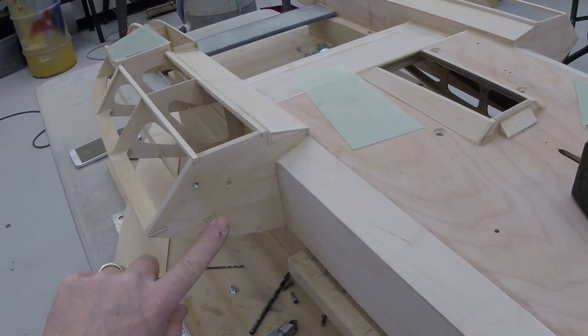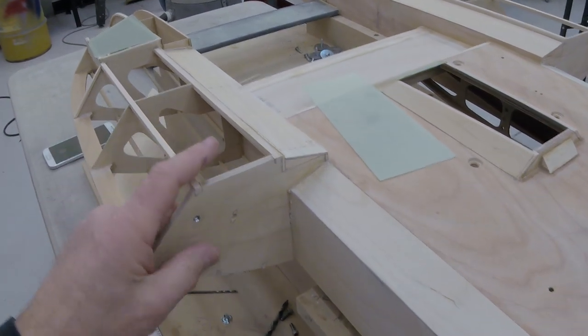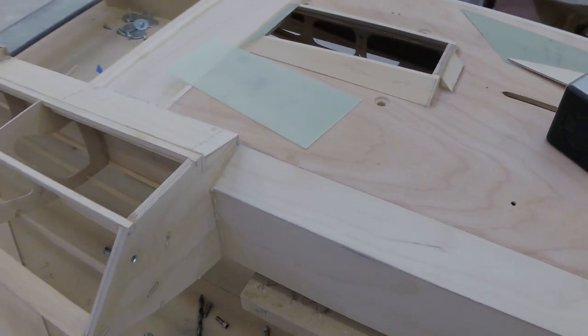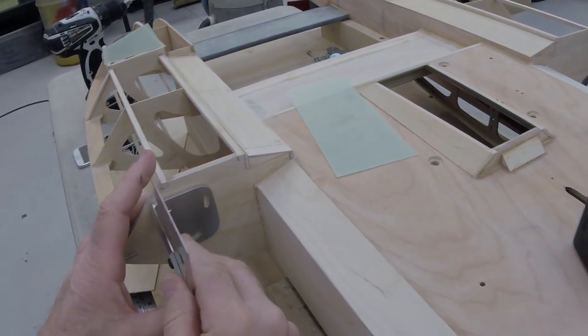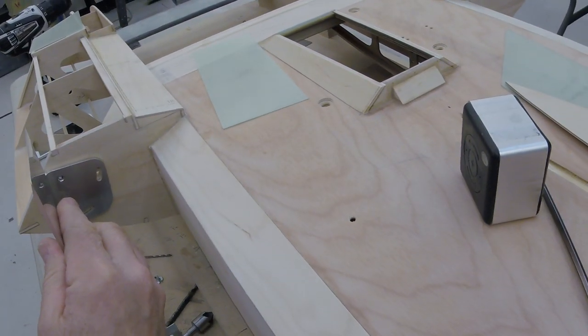Even if you don't have an adjustable bracket, you know, pick a spot. Maybe you want 12 degrees, maybe you want 14. I really think I'll probably wind up at about 14. It's where I usually hit. I don't use curved fins. I think curved fins are super, super persnickety. Boy, you better get it perfect, and if it bumps or moves or wiggles, then it just does nothing but make the boat angry. So we got one hole done.